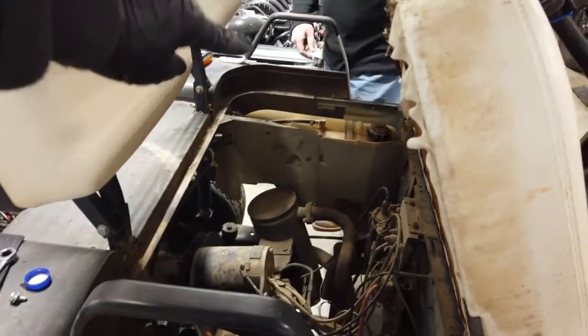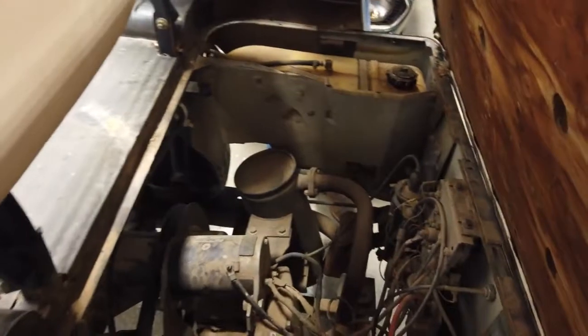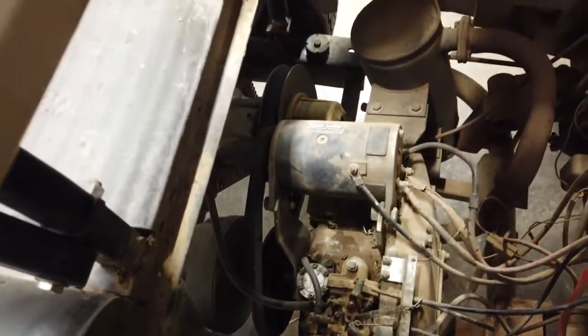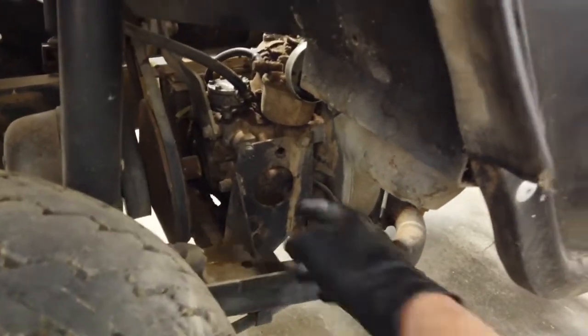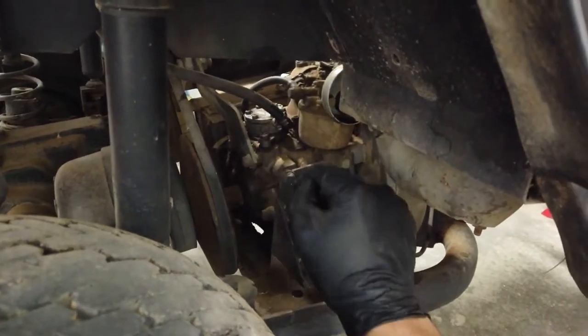So we just got to more or less figure out how to get fuel over there from the fuel tank to the carb. And who knows, maybe there's a small blockage in the carb or something. It's hard to say. Good news, bad news. Good news is we got some fresh line here. We checked. If we feed fuel in here and let it sit, like putting a syringe of fuel in there, it will push it through the pump. It pushes it up to here, replace this line. And then if I take a little syringe of fuel and squeeze it in the carb, it'll fire off and run. So it's just not getting fuel from the feed through the carb into the engine, which makes sense.